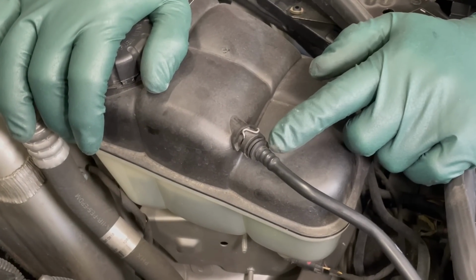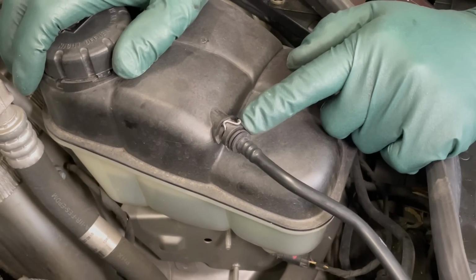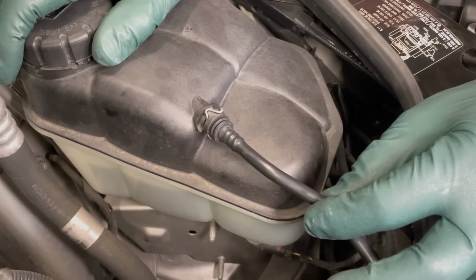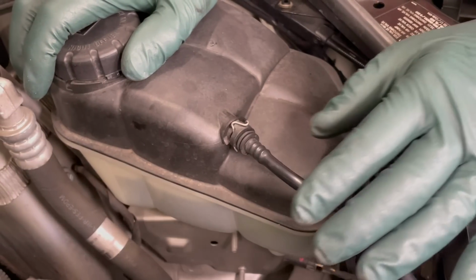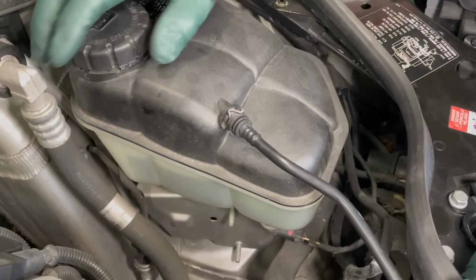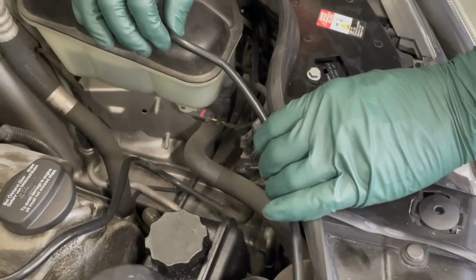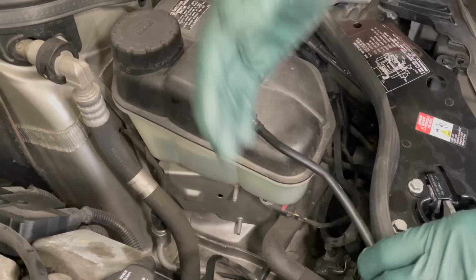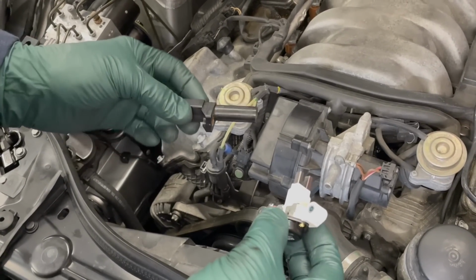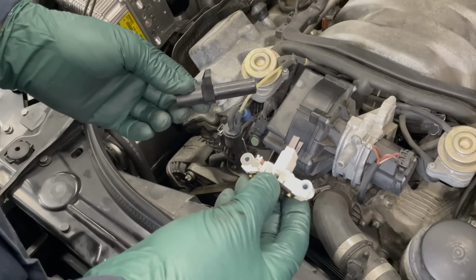This next item is just a very small item that I add to my inspection. This little nipple coming out of this tank is prone to break. This hose gets very stiff, and that's plastic. I'm going to warn you, be very careful working around this engine. You bump this a few times, you're going to break that off. What I like to do is sometimes drill a hole here, come in here and put a clamp right there. Clamp that up tight, and that's going to reduce some of the potential for knocking and breaking that fitting off right there.